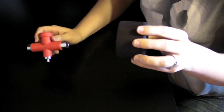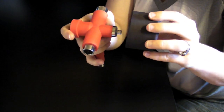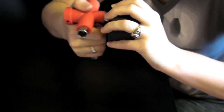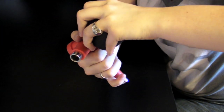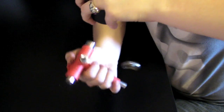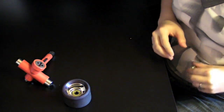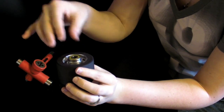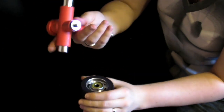For the aluminum hub, hold the wheel sideways, take the tool and push upward like you're going to pry it out, but instead of prying, just pull away. If it doesn't come out, hold it upside down and do the same thing but pull downward instead, since you're holding the wheel upside down — that will help it come out a lot easier. Putting it back in is the exact same as with the plastic: just stick it in and press down. And that's how you use the Reflex Utilatool.